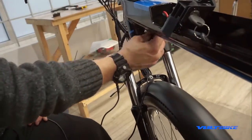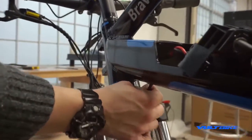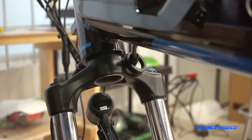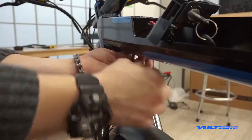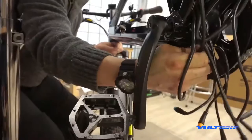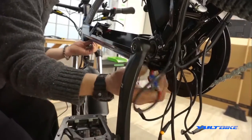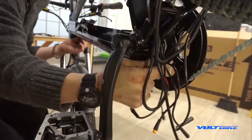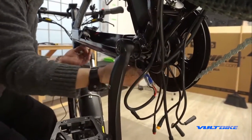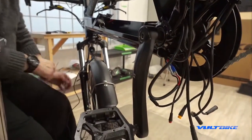There are also two other lines running through the bike: the hydraulic brake line and the shift cable housing. We're not going to remove those, but to make installation easier, grab them from both top and bottom and move them over to one side of what we'll call the wire chute. Now the two remaining lines are off to one side, giving you a clear slide for the new harness to be installed.